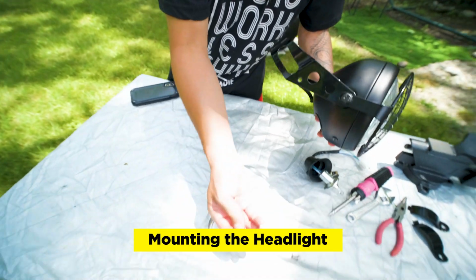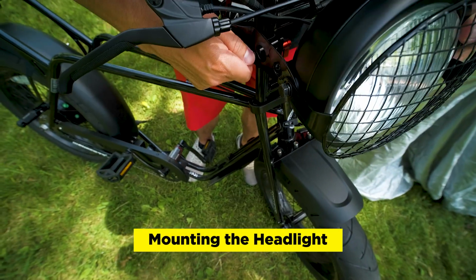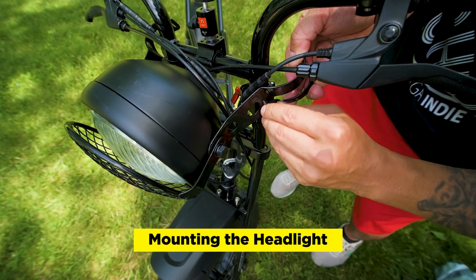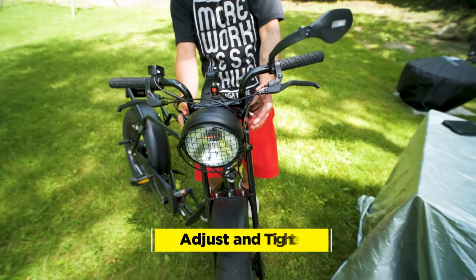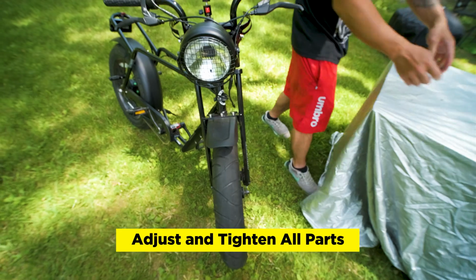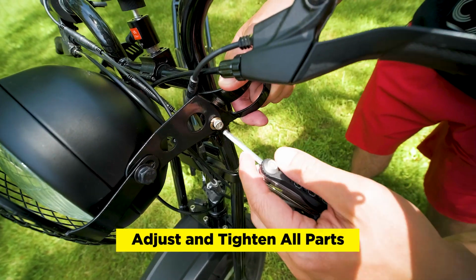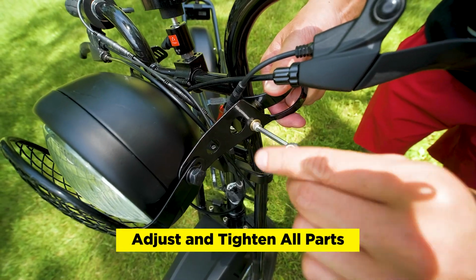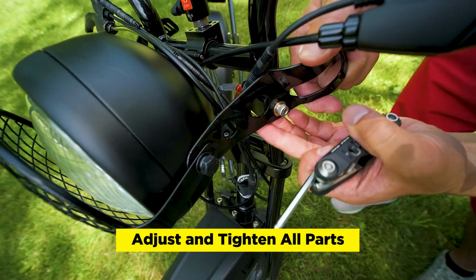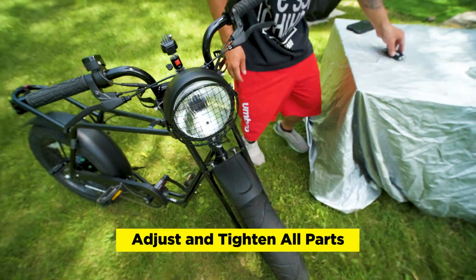And then next we'll take our washer and we'll take our 1/4 screw. Just hand tighten that. And we'll just hand tighten that. When you feel like you have everything sort of like equal, you could start to tighten everything down. We'll start with the Allen key. Straighten out the bracket so it's sort of like a little bit symmetrical, I guess. So it's lined up with the edge of the bracket and the edge of the clamp. That looks good. And then we'll take our wrench.